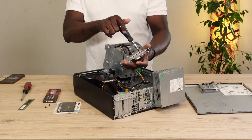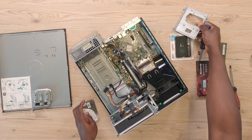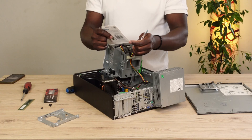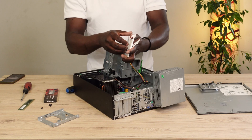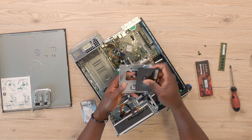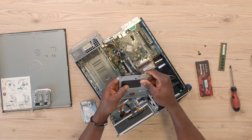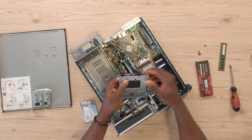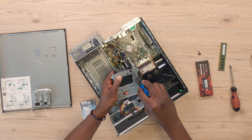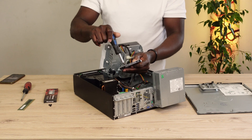Now this is the third screw — just have to take that out as well. At this point, I have to go ahead and unbox my SSD. This is a very good SSD. I got this off Amazon and these things are getting really cheap these days. I'm going to be leaving a link in the description where you can get one of these. Now that we have the SSD, all I have to do is reverse the process — take the SSD right into the holder and go ahead and screw on the screws. Sometimes it may be difficult to get a hold of the screws because this screwdriver I'm using is not magnetic, so it makes things a little bit difficult.